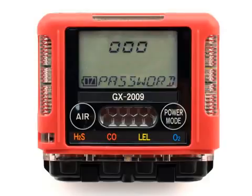If on is selected when the Power Mode button is pressed, the screen will show the current four-digit numeric password. The first digit of the password will be flashing. To accept the current setting and advance to the next digit, press the Power Mode button. To increase or decrease the numerical value of a parameter, use the Air button to increase or decrease that value. To accept the value, press the Power Mode button. Repeat the digit selection process for all four digits using the Air and Power Mode buttons. When the last digit is selected, the unit returns to the password menu item.